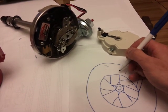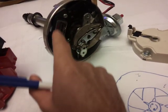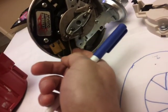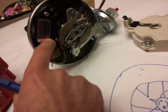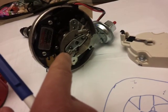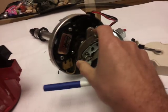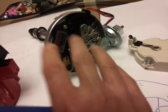There are two wires coming from the pickup coil and they go into the module. This one here is a four-pin module — one, two, three, four. Those two wires go into one side of the module. A four-pin module — two and two — is more for carbureted motors which use mechanical timing and vacuum timing advances. This is pretty much a self-contained distributor.